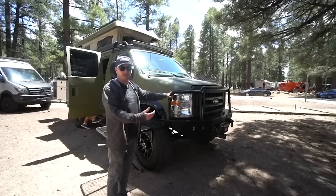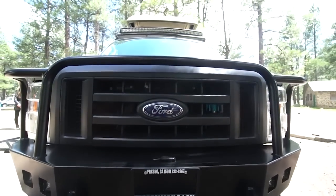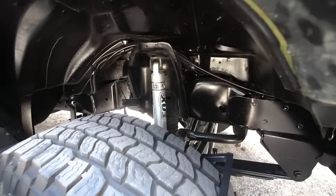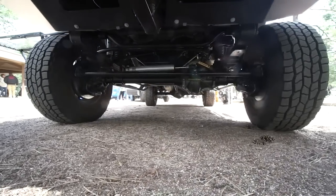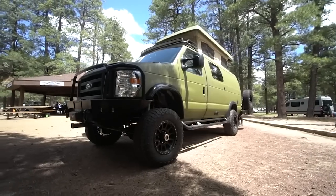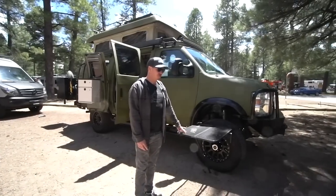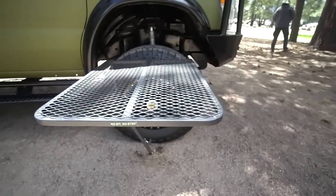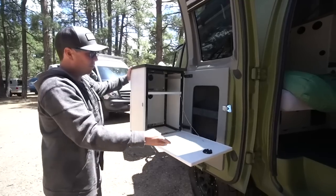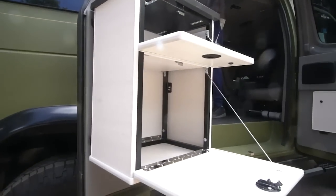On our Ford Econoline cutaway chassis, Ford also doesn't make a four-wheel drive van, so that's something we do as well. We strip all the front end down and put a Dynatrac Pro Rock 60 straight axle front end in there along with our own Atlas II advanced adapters transfer case. All the suspension is custom — Fox Shocks designs and valves the shocks specifically for the weight of the vehicle. All springs are custom, giving about a six-inch lift over a standard van, so we can fit 35-inch tires with plenty of clearance. This is our tailgater tire table — a cool accessory. We also have our galley cabinet here that drops down on both sides for portable stoves, and you can cook right here or bring it to the table or outside.